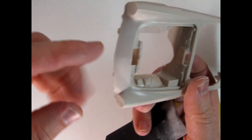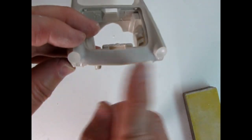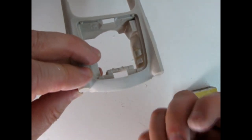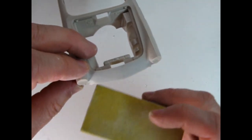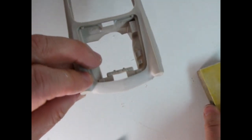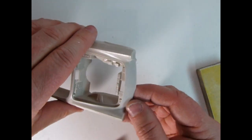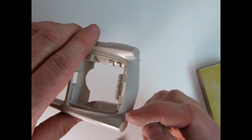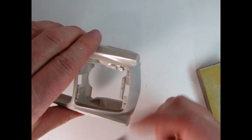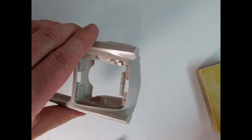There's the front now de-chromed — it no longer has that Thunderbird emblem. The reason I'm using 320 grit sandpaper is that it is a lot finer than the 180, which would put in some pretty deep scratches. With the 320, I can then clean it up with 400, 600, and even 800 grit sandpapers afterwards, just to smooth it all out.